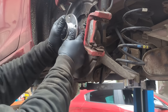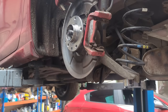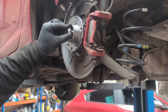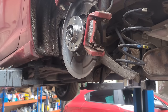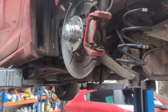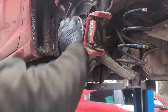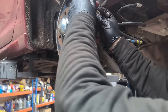The new wheel bearing is normally a little bit tighter to fit. Use a socket to give it a small tap on — not getting it heavy at all. On with the washer. On with the new nut, which is the same size. Wheel bearing spins. New cover into position. Another light tap with the locating tool. And now let's start putting it back together.